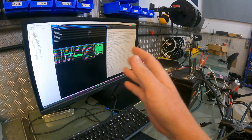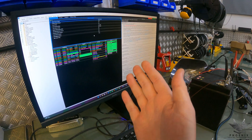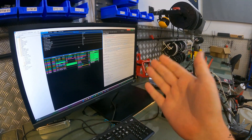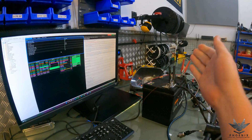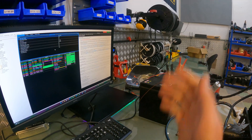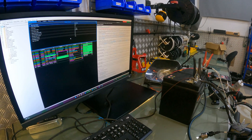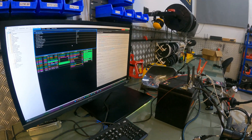So how exactly does it work and what wires are we using? For the most basic version, all you would require is some kind of signal to the ECU to tell it that the vehicle needs to start cranking. In this case we're using a digital input for starter control. In our harness it's built into the fuse box — you just send a 12 volt signal to it and then boom, it will do that. Because it's using a digital input, you don't necessarily have to use a 12 volt trigger — you can use a ground trigger, and that can be changed in the settings.